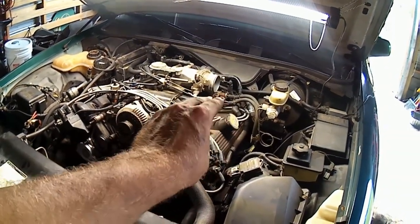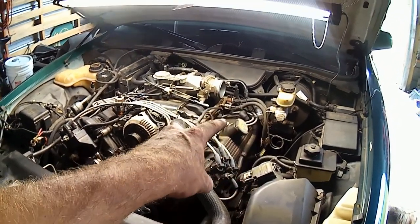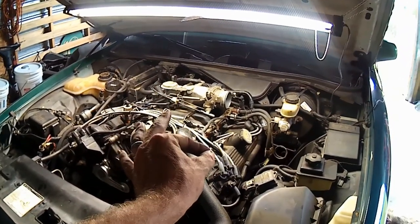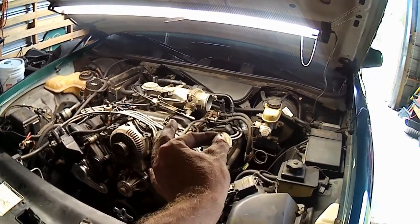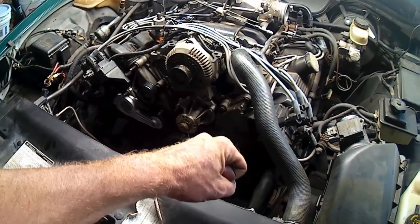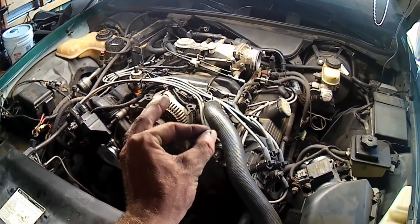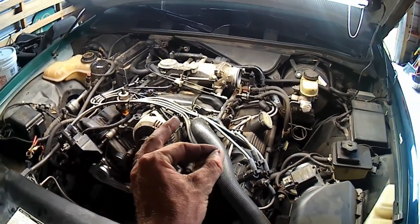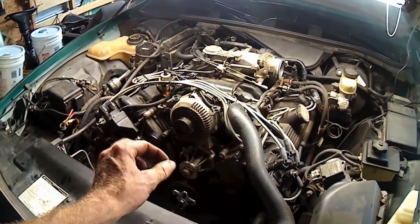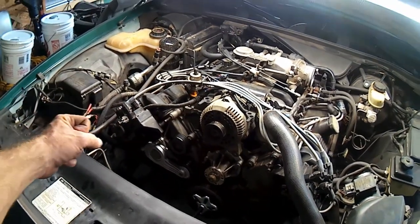your transmission. So I popped that off, rolled the motor around to where I could see one of my 9/16 torque converter bolts, took a 9/16 deep well socket, slid it onto it, and then when I came back over here and went to turn on the crank bolt, it rolled a little bit, went click as the socket hits the top side of that access hole, and that held the crank steady for me, so I could just pull nice and gentle, didn't even need to slap the breaker bar or the hammer